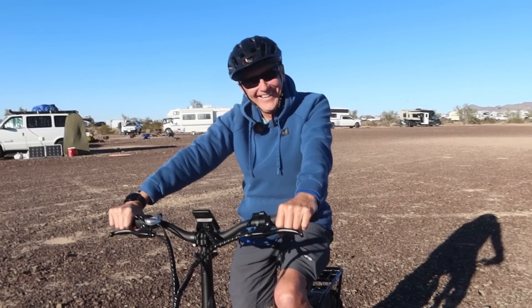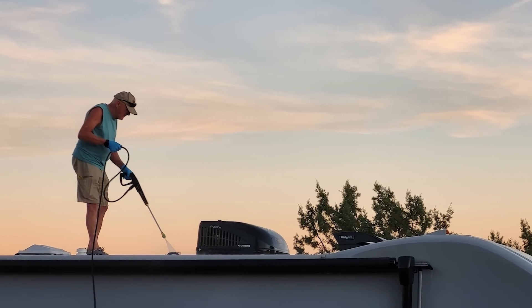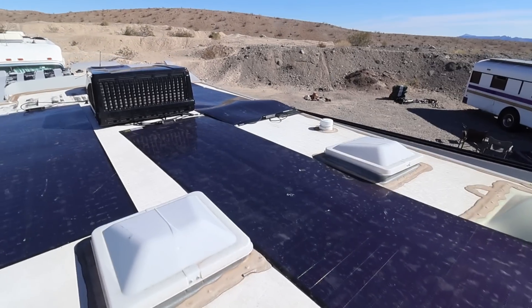The other two panels I have installed are the adhesive type. For roof prep, I had Kevin from Canada help by thoroughly pressure washing the roof with soap and water first. This RV has a textured rubber roof, so it's perfect for using the adhesive, but it needs to be perfectly cleaned first. After the roof was washed and dried, it was then cleaned entirely with isopropyl alcohol — it took about five quarts to do the entire roof. After that completely dried overnight, the solar panels were applied one at a time, starting with the front and working toward the back. The grommet panel was installed last with typical roofing screws with rubber washers, and lap sealant was applied over and under the holes.